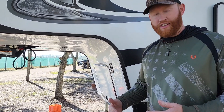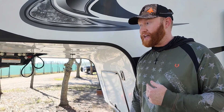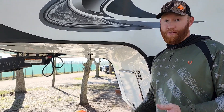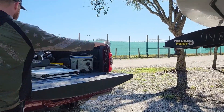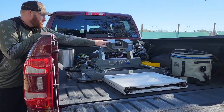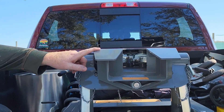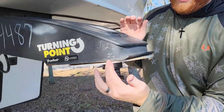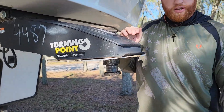The biggest thing I would tell you before hitching up: make sure your tailgate is down. You wouldn't believe how many times this happens — it almost happened to me. That wouldn't be good. You're going to want to get the RV raised up, and when you come in for the connection you're going to want to hit this lower ramp right here with the kingpin — see how it angles upward — that's where you want to hit.